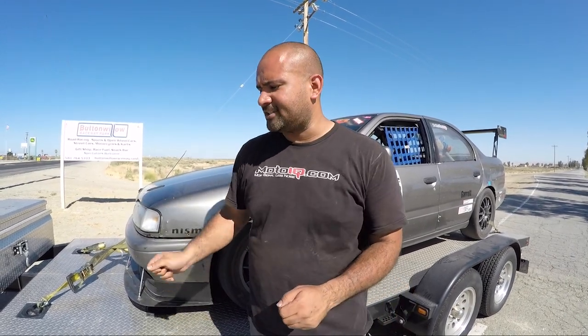When I came off track the very first session, I came in hot, right into the pits to check my tire pressures to set my base tire pressures for the day. During that amount of time that the car was on, the car actually pegged the water temp gauge. Thankfully, the head gasket was not compromised. Everything is checking out, everything is fine. All I really needed to do was manage that throughout the day. So really all I had to do was take a solid two cool down laps before coming into the pits, and the car is perfectly okay. No issues as far as that goes.